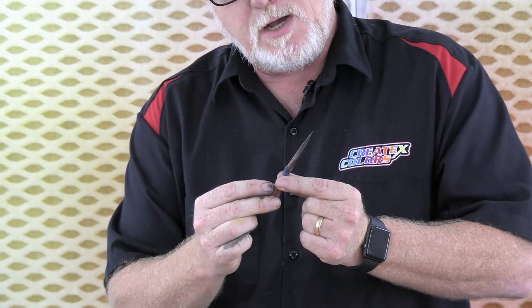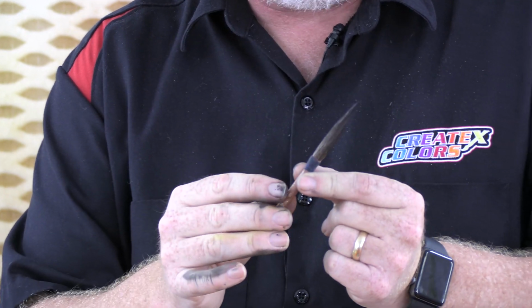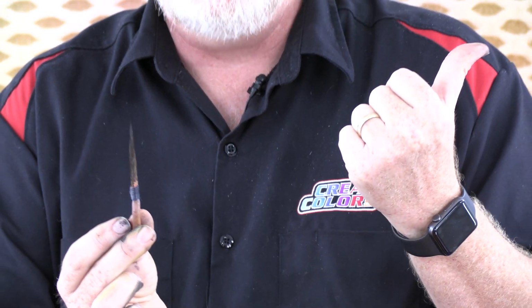And by the way, the brush I'm using here is a little bit different than the lettering quill I used before. This is called a striping brush. This one is actually made by Mac Brushes, and it's called a Mac 10. This is a single aught brush. You need to kind of trim these when you get them, but they're pretty close. They're not as shaggy as the green ferrule. You're looking for that blue ferrule there. And you always want this stick to be facing to the left. So if you're a right-hander, your thumb goes where that stick is.